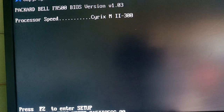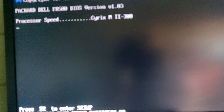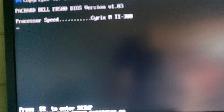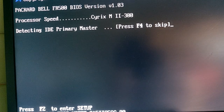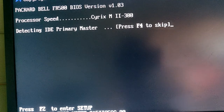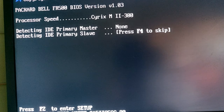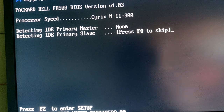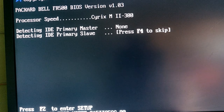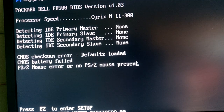This is a new hard drive. So what's going to happen in a minute? It'll either say something about no information or that it won't be able to boot. What you need to do is go on the passion-pb.fr website, and on there is a tool for creating a tattoo floppy. So you'll need a computer with a floppy drive or external floppy drive. Yeah, disk boot failure.